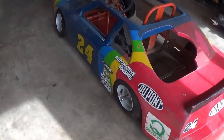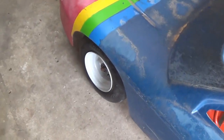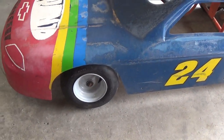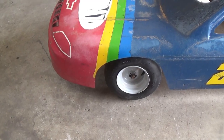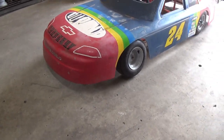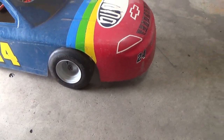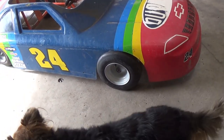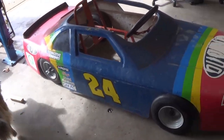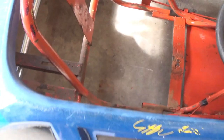There it is — the body's on and wheels are on the orange frame. As you can see, that's not centered. This is really bent and cambered. The front needs narrowed and moved forward; it's not centered because it's still bent. When I redo that front bar, that'll fix everything. I like the ride height but it's not even — the front's higher. This wheel is holding it up, so once I get the front axle bar done, that'll fix the height. The back's too low back there. The seat frame needs bent backwards — it's bent forward some, but that's an easy fix.